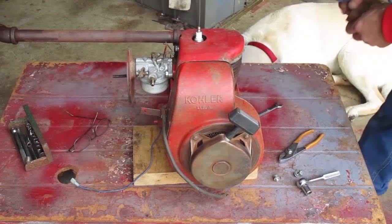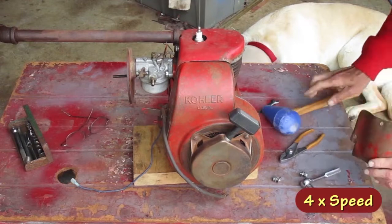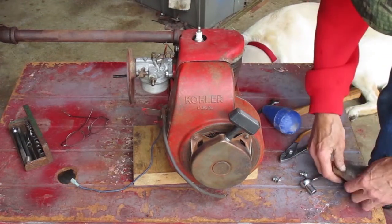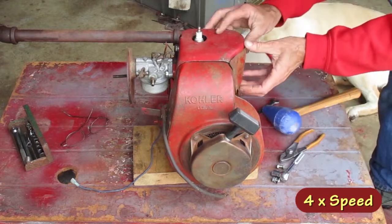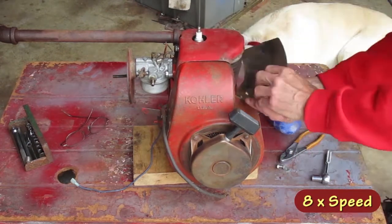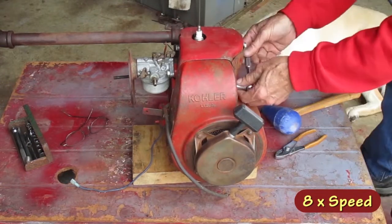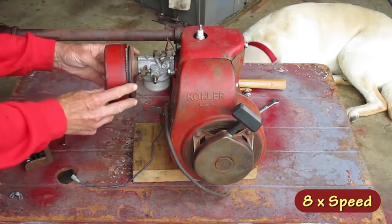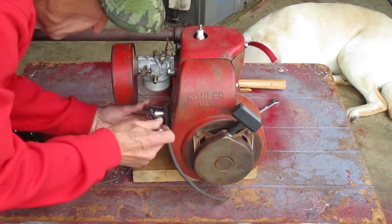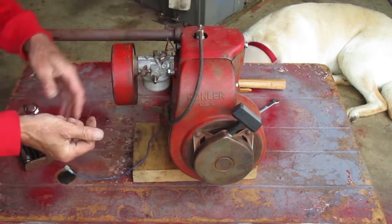The bolt hole's squashed in some, so I'll hammer that back out where it should be. That helped the shape a little. Now it needs to flex inward. That bit's pretty good now. I want this choke cable bracket positioned so it'll point the cable right at the choke lever, and I want the plug wire clamp rotated so it's square with the world.